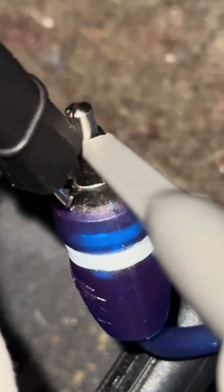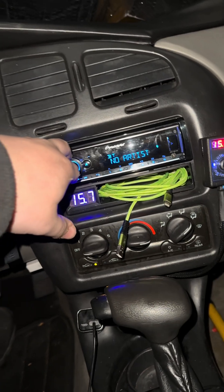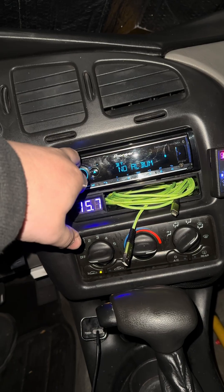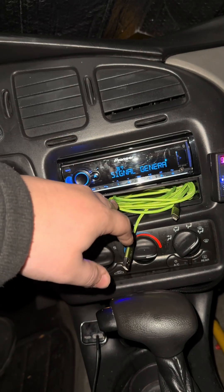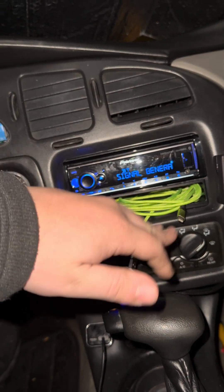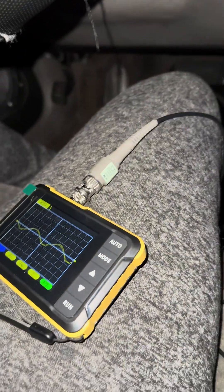The positive is on the inside of the RCA and ground is on the outside. You can do a 40Hz test tone at 0dB, or 20Hz, or even negative 5dB on any of those if you're doing rebass music. I'm going to turn up the radio until I see it clip.